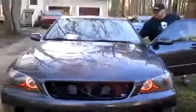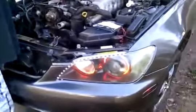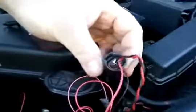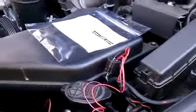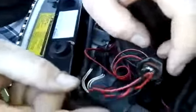And there you have it — your LED strip installation on a 2003 Lexus IS300. Like I said, you don't necessarily have to do it my way. I just got lucky that there is a city light. If you want to wire it directly into the actual headlight, all you've got to do is cut the wire here, figure out which one's power and which one's negative, then take a butt connector and connect the two correct wires together, and you're all set to go.